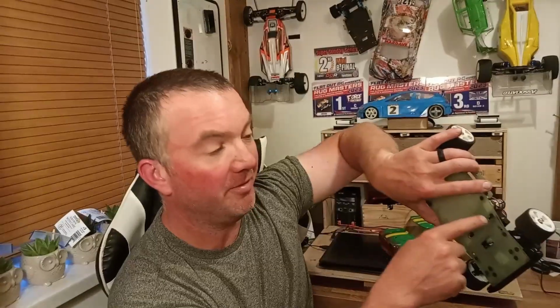So a solid Q2. Q3, Q4 were both DNFs, and they resulted in an awful lot of flapping, because I ended up rebuilding the front end twice, because I just thought there was something wrong with the front end. The car all of a sudden just wouldn't steer. I couldn't find a fault at the front end either. And it turns out the steering servo was actually loose. So the 2 little grub screws that I had holding the servo mount towers in, it just worked them way loose.